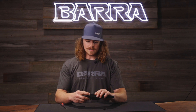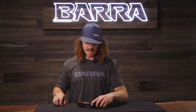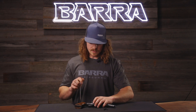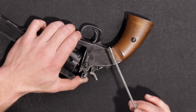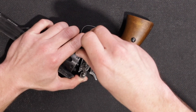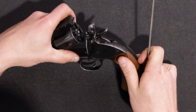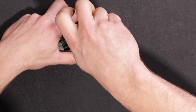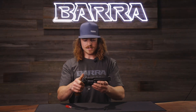The first thing to do is look on the side of the gun. This latch right here is pretty loose. What you want to do — there's a little spring on the right side of the pistol, and you can see it right here. The best thing to do is to actually push the latch down with your thumb and then tighten that screw, because there are threads in the hole under the right side. Once you tighten that up, that should keep your latch in place. On the left side, just make sure that this screw is tight enough and snug to keep that in place.